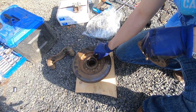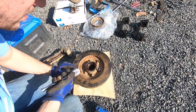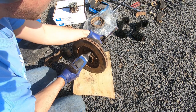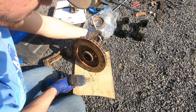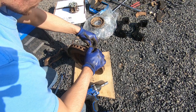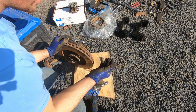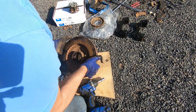That gives you access to the bolts that hold the rotor to the hub. It's 14mm on the front, 16mm on the back. That's probably stuck in there pretty good. Don't forget — there's the bolt, the washer in the front, the lock washer, and then the nut. I'm going to do the rest of them and we can compare sizes.